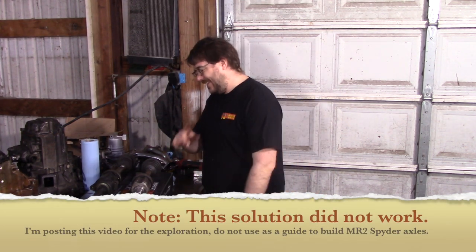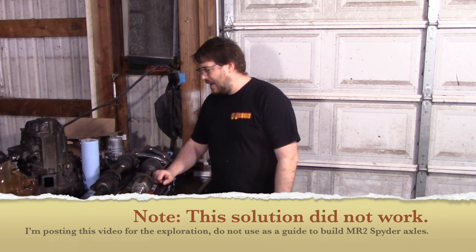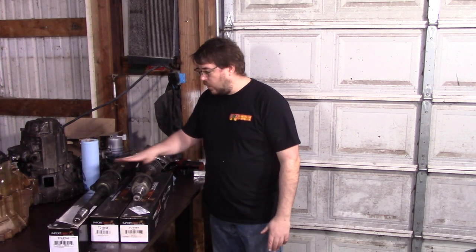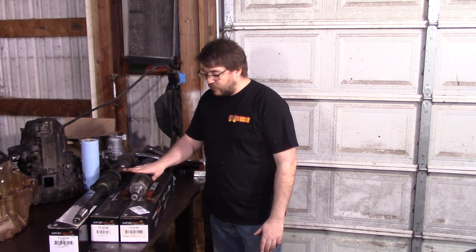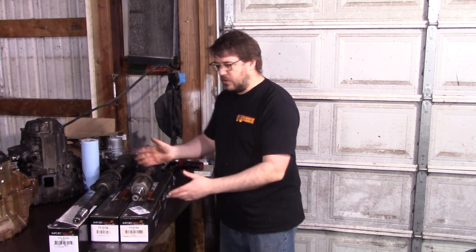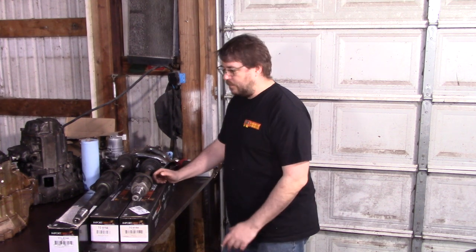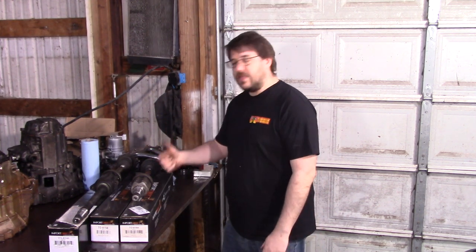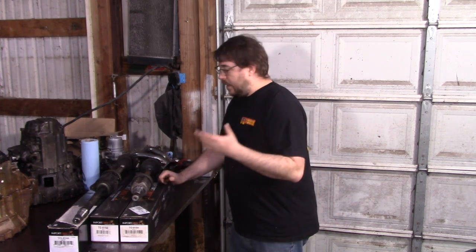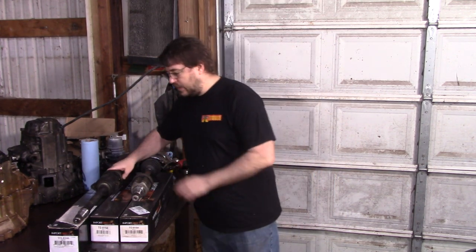Unfortunately I lost the instructions, but this should be relatively easy to figure out. These two are spares that I have right now. If it's not inherently obvious just by the length of the axles, I'll bring the car in and we'll test it there. But either way, at the end we will test fit these on the car to confirm they're good, confirm the plunge travel — that there's enough travel going in and the joint's not going to come apart. First things first, let's unbox these things.